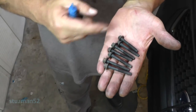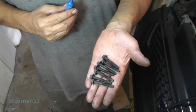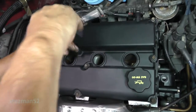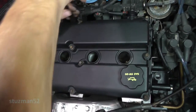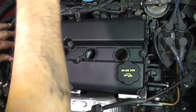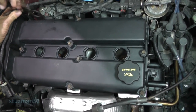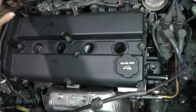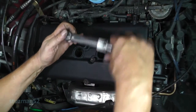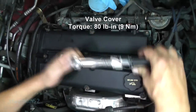For your seven bolts, I'm going to put a little bit of thread locker on each one and screw them into the remaining holes on the valve cover using an eight millimeter socket. Start from the inside and work your way out, criss-crossing. I've already gone through it but I'm just making sure all of these are correct.